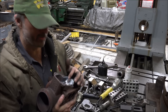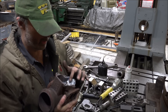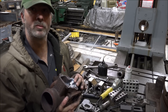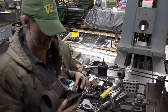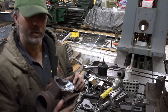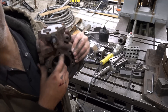If you have one of these very common S300 exhaust housings with dual wastegates and you want to make it better, that's the way you can do it. Just remove the guts out of it, open those ports up. You've got to be very careful that you don't go too far or you won't be able to get your wastegate sealed and then this housing will be junked. 5/8-inch is where I stopped — you might be able to go bigger, but that's as far as I would definitely want to go. There it is, welded back together. Nice and free.